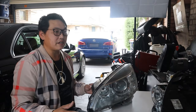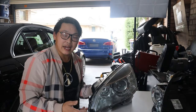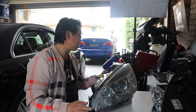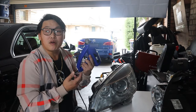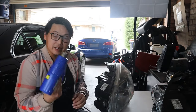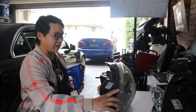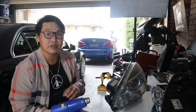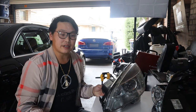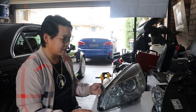Use a cardboard box — you just need a confined space that can evenly distribute heat around the whole headlight to heat up the mastic. I use a box that is a little bigger than the headlamp and a heat gun set on either low or high. Be sure to keep track of how and where you're heating it. Do not point the heat gun directly at the plastic or you're going to melt it — point it away from the headlamp. Some people also use an oven; just put the headlamp on a towel to absorb heat.